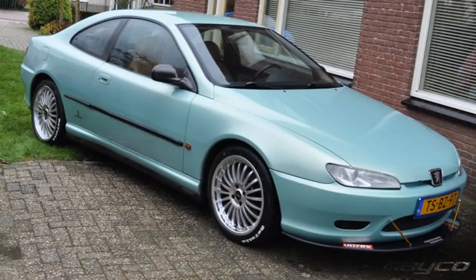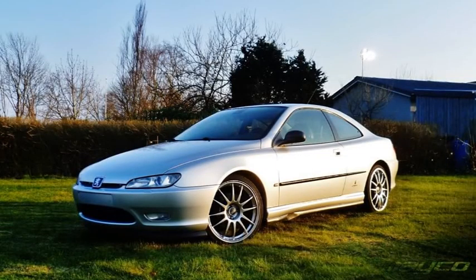These wheels that I have were branded for a Citroen, 18-inch, 4x108, and offset is 25. I have 15 mil spacers, so I drive on an offset of 10, and factory wise it's offset 12. So I'm quite close to the offset. But I personally think that 19s look the best on the car, and go for a deep dish.